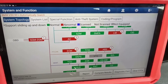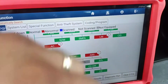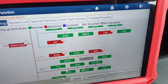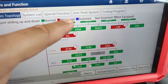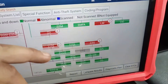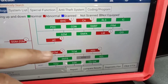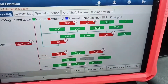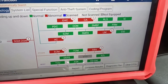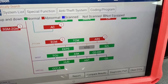They don't know exactly which modules this car has fitted. They will try to communicate — it doesn't answer, there is no communication. It will show you only modules with errors, scanned modules, and not-scanned ones. When you try to scan the modules, all of them appear in white color at first. And as I said, the gray color doesn't always mean this car doesn't have these modules — it can also mean these modules have a problem.